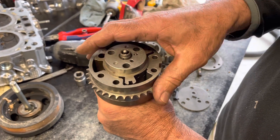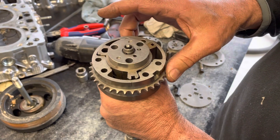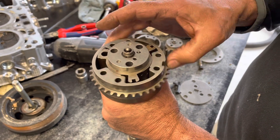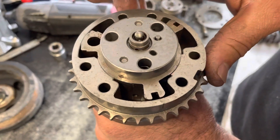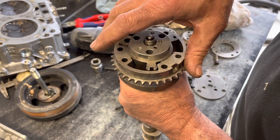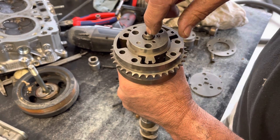It's like 30 or 40 degrees of valve timing - I'm not sure exactly what it is, you'll be able to read it up and find out. But that's basically how far it is; if you measure that you can see how many degrees it can vary. I thought it was only a couple of degrees - no, it's massive. And it's done through oil pressure - that's real pressure.